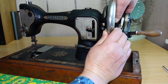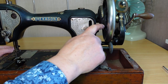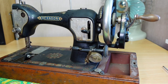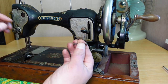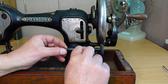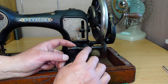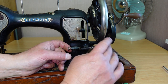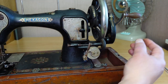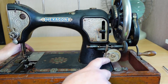I'll disengage the stop motion there. It's also treadle capable — we can see there's a V-belt groove here to accommodate a leather belt for a treadle machine. Let's place a bobbin in the holder — it's a spring-loaded mechanism. The right hand side locates into the spindle, likewise with the left side. Then we engage by bringing the bobbin winder rubber against the hand wheel. It's a very similar setup to a Singer. Place the thread on the spool holder, come over to the left hand guide, then down to the guide at the bottom of the bobbin winder, up to the top guide.